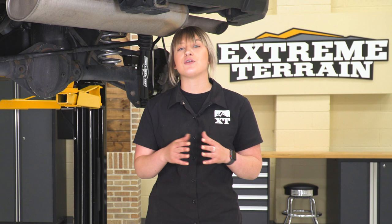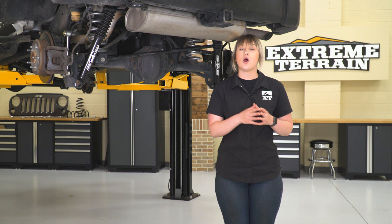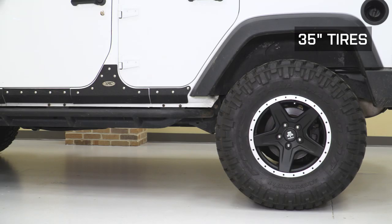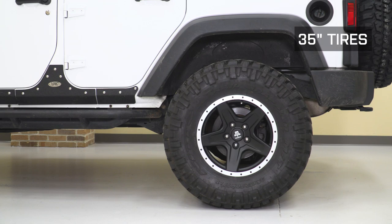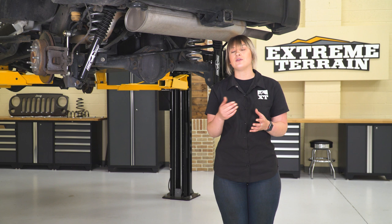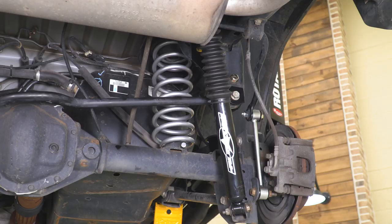Twin tube shocks are really not made to be worked really hard like a monotube shock. So if you're looking to do some harder trails, or work your shocks hard like bumps at fast speeds and want that shock to last longer, then a monotube shock will be right up your alley. A monotube is going to be a little bit different as far as internal design goes — more efficient separating the oil and gas into chambers, which I'll talk about in more detail later. This is going to be for somebody who's looking to split that trail and street performance.